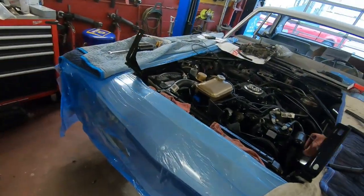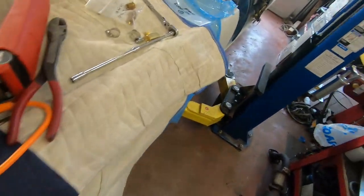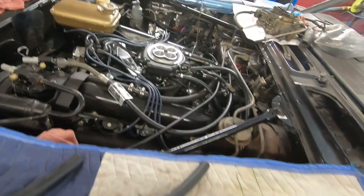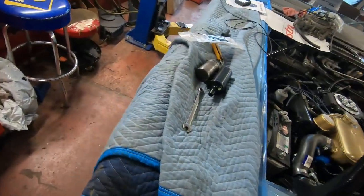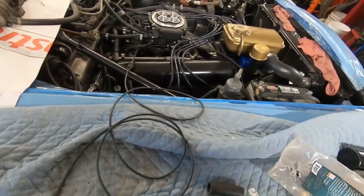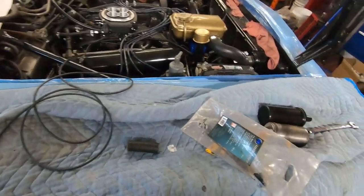Over on the Lincoln — it runs, obviously. If you saw in the last video, it ran really, really great until the oil spewed all out of it. So underneath the car, kind of just above the oil filter housing actually, there is a plug that was missing out of the filter housing. So when we were starting it and it built up great oil pressure, it all came rushing back out. I guess when the engine builder rebuilt the engine and put it all back together, he didn't put that back on — didn't know if it went back on — so we found it the hard way.